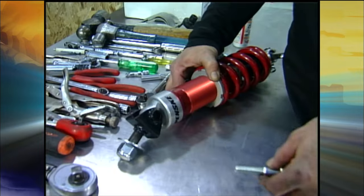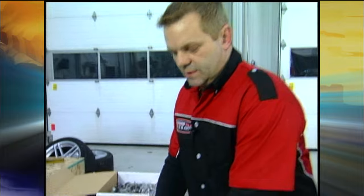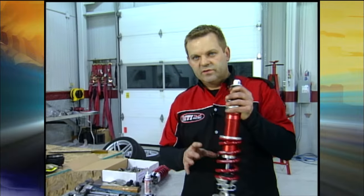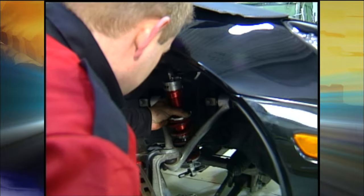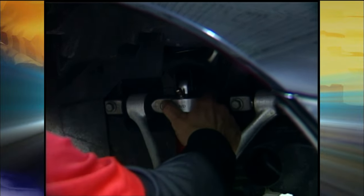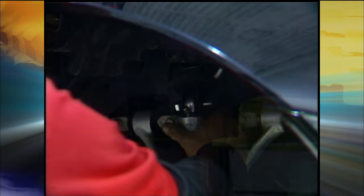We dialed it back a couple of steps for something tolerable on the street. On our coilover shock arrangement, we use a mono ball — we changed from a stud mount to a mono ball assembly. Using a mono ball instead of the stud style eliminates all the side loads in the shock and spring assembly, letting it go through its range of motion without friction. We had Penske build an adjustable shock that uses one adjuster to control both compression and rebound.